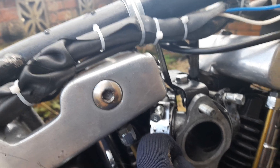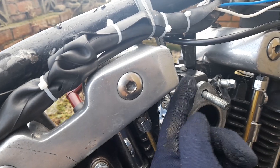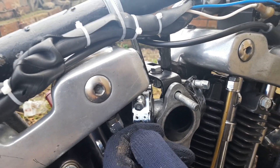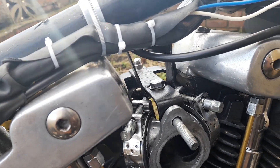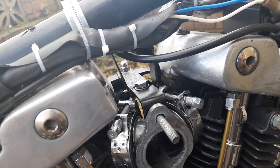Now this bolt does really get in the way — you can't get that out. You can't do up a Super E from that end with that bolt in the way, so it has to come out every time you change a carb right here. For most people, that's not that often. But that's my solution. I've had it for about a month and the rubbers are still fine — it seems to, of course, solve the problem.